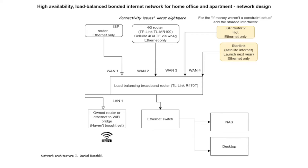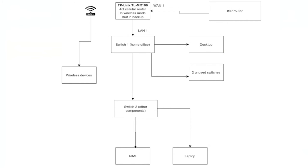That was kind of an elaborate setup, and it would have involved four routers — a lot for a home. So this is a pared-down, simpler configuration. If you want to do this, you're only going to need one additional router. So that's two routers in the house — ISP and TP-Link — which is obviously simpler to configure. What I've done is put the ISP router into the TP-Link's WAN port.